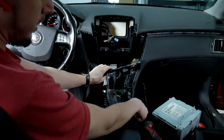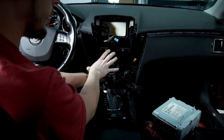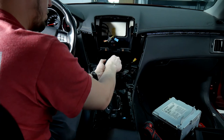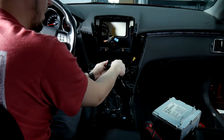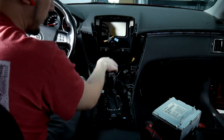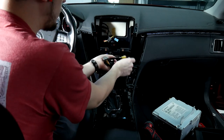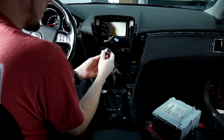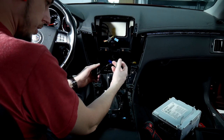The wires came out right down here in the floorboard — we don't have to worry about that for now. Once we get everything back in minus the bezel up front, we'll tuck them into the glove box. I always start with plugging in my quad lock first, making sure this clip clips into place fully nice and snug. After that I'm going to tuck it back just a little bit but make sure I'm not in the way of any other cables. Hook up the other side of the T-harness — the female here goes under the factory male, and these two parts of the T-harness are going to plug into the radio.